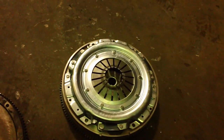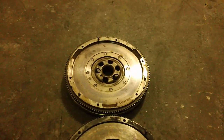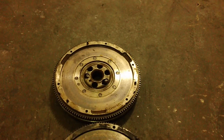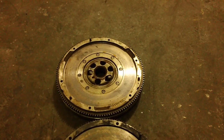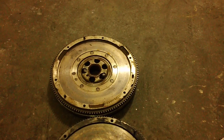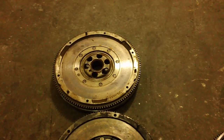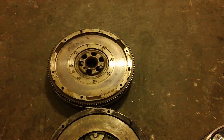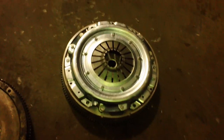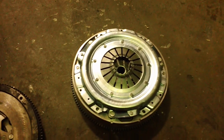Nobody really goes with these — everybody pretty much goes with the single mass conversion, and you can save yourself five, six, seven hundred dollars. I think the list on these is actually like a thousand in some cases. These are used in basically all 1.8 turbos, 24-valve VR6s, S4s like the 2.7 Turbo B5 S4s, and B6 S4s. Basically almost everything after '99. The 99 through '02 12-valve VR6s still use a solid flywheel, if I remember correctly. Just go with the solid mass conversion and you'll be happy with it — it'll be cheaper, you won't have to worry about it breaking, and do it once and just be done with it.